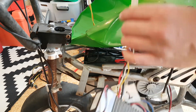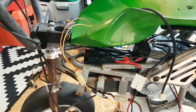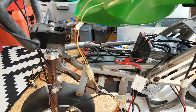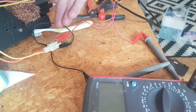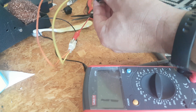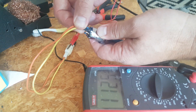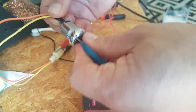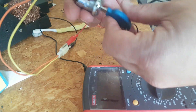Moment of truth — that was a bit loose. Nothing. Okay, take it away — nothing. So I pulled the jack out and got two crocodile clips connected to my multimeter. Turn it on — nothing happens. We're trying to jiggle this around. Look how much play there is in the switch. If you bounce it around on the bike, it's going to turn on and off the whole time. So the switch is going to go — it's not really worth replacing the contacts in it.